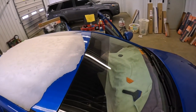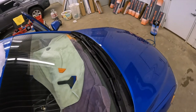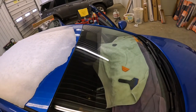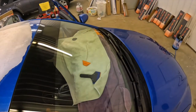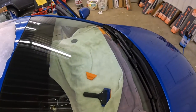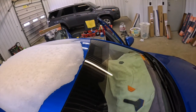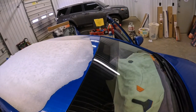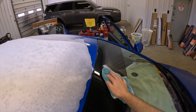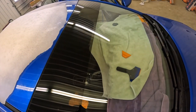There you go — perfectly even. We measured it, it's going to be within a sixty-fourth or so. Another thing to consider: if this has aftermarket glass — which this does not, you can see the Hyundai logo — but let's say they had the windshield replaced. Sometimes these windshields can be slightly off-centered, up or down a little bit, and you can have silicone squeezed out on the glass. Take note when you're doing any car: if you're going to do a strip, check if it's got a rock chip fill, if it's been replaced. Inspect the inside before you start cutting, because nothing is worse than having your pattern cut, getting it in here, and finding out the edge won't lay down and you've got to cut silicone out. It's easier to take a quick look beforehand and get it squared away. That's all I've got — Doug Lane, Fastlane Car Care, single-piece windshield strip — that's how you do it, start to finish.